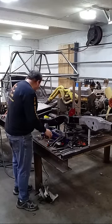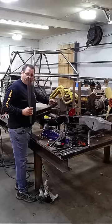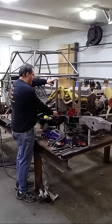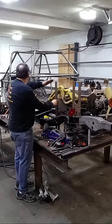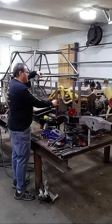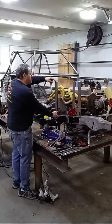But I'm going to have a tube right here, okay? My mid plate right here. I'm going to have a tube right here. And that tube right there, we're going to figure out as far as deck height and all of that. We want this to be under it. But we're going to have this tube, and there's a couple ways I can do this. I can either come off this and then have a bend and then run across this and bend down 45, or I can use this like a node.